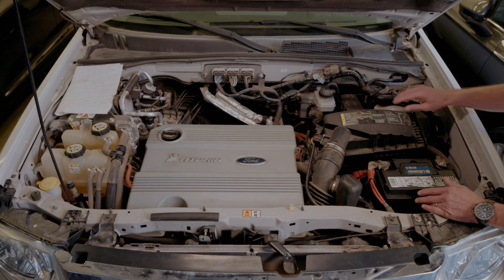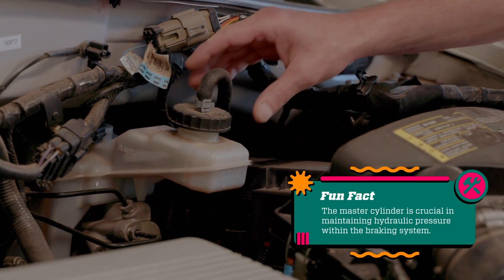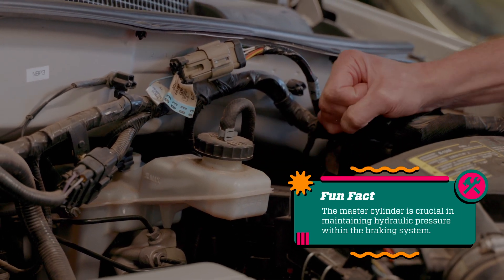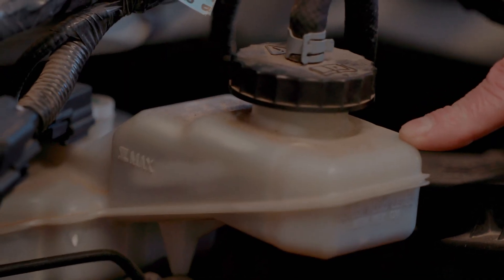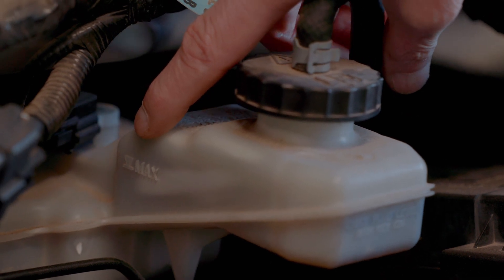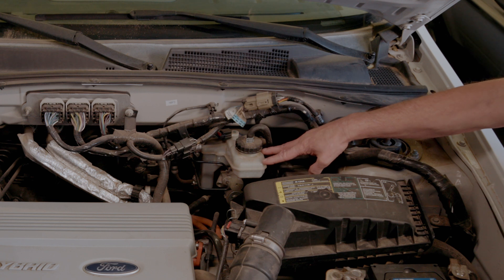The other thing that we can take a look at is your master cylinder, and this is for your braking system. Federal Motor Vehicle Safety Standard 135 prevents us from opening this to allow any air or water to enter the system. So manufacturers, to comply with that law, have made our reservoirs clear and have also marked an area on the reservoir where they want the fluid to be. Brake fluid should never be added as a routine maintenance thing before your brakes are inspected.